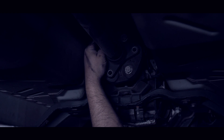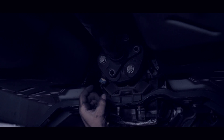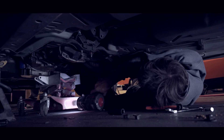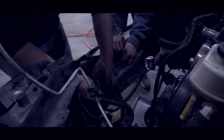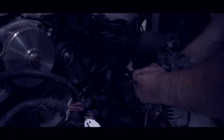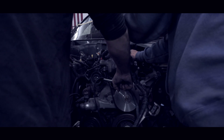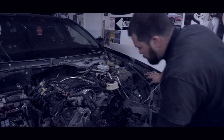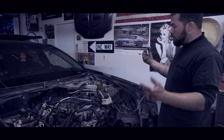We're trying to get to the top drive shaft bolt, and I'm going to have to look into what type of U-joint or rag joint I'm going to need for when it goes in the Camaro. We're also going to pull the power steering pump off so that we can hook to the engine with our hoist and pull it out.